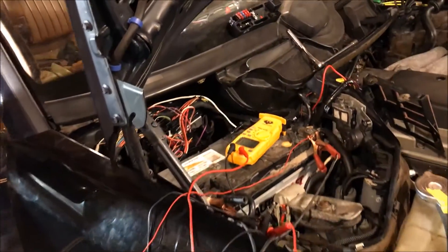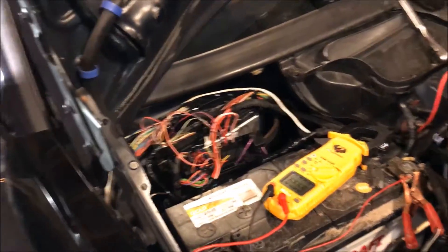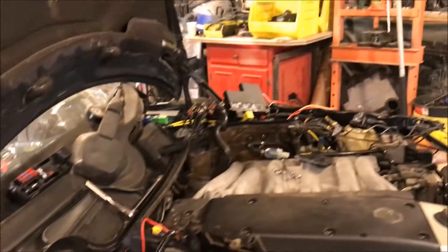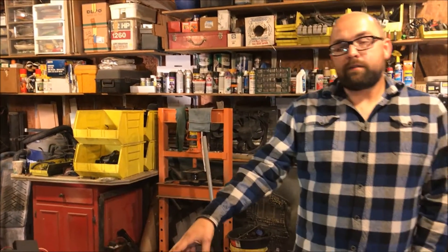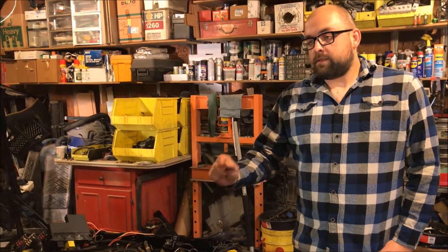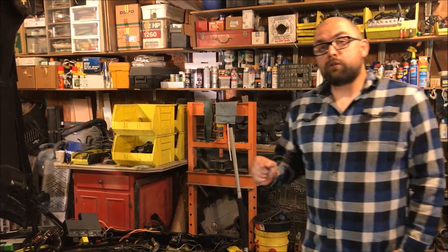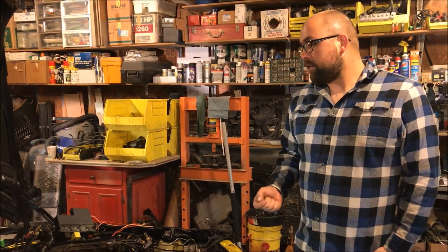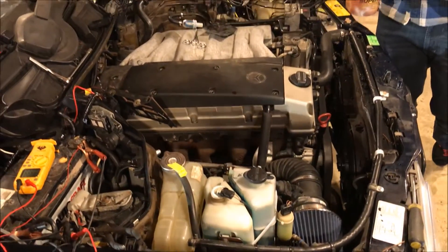We have our K40 module that we tested here — we picked up another one to try out, but so far it doesn't seem to be connecting. We are able to hotwire the starter where it tries to start and we see the shutoff valve open, but it seems to cut off right after we try to start it. So right now we're trying to figure out if there's an immobilizer issue or something else causing the motor not to start.